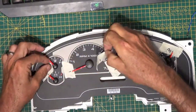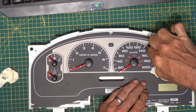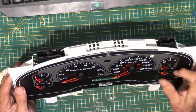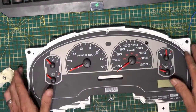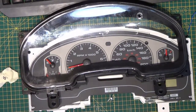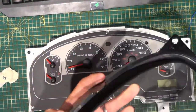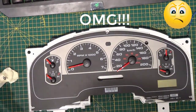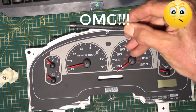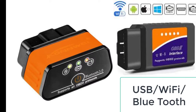Okay, that should do it. I won't bore you by having you watch me take this thing apart a couple of times and leaving out all the curse words, but I finally did get it all together and back into the vehicle. Then we had a little bit of a problem — because I had those stupid needles on and off several times, I'm pretty sure that the alignment is off. I put it in the vehicle and sure enough, there's a couple that aren't reading properly. While I was in the vehicle, what I ended up doing is resetting some of the gauges — when you plug in the right hand connector, the assembly moves all the needles back to the middle position. I'm going to be using an onboard diagnostic connector scan tool with my laptop to verify the speed and all the other parameters of the instrument cluster.